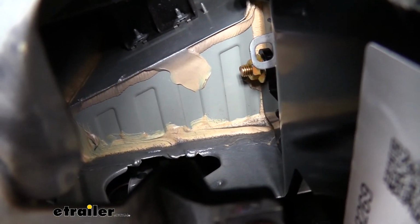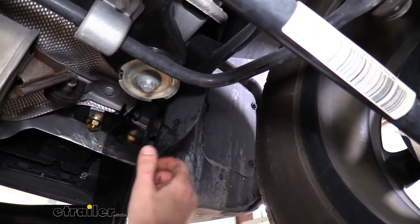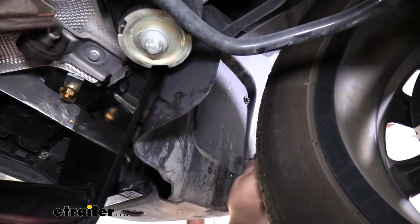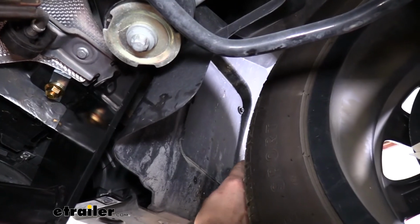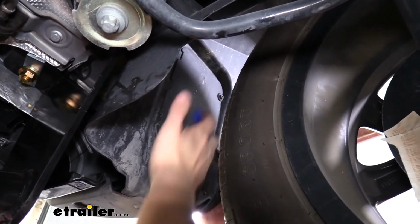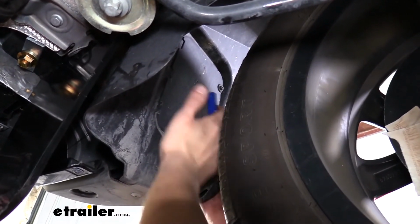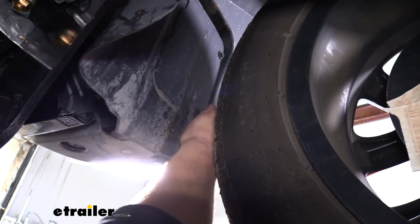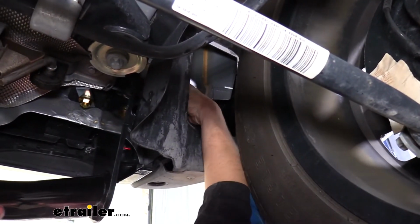On your driver's side, there is an access panel we can remove to make things a little bit easier. You can see here that clearance is even tighter, so we're not going to really be able to get our hands up in there. But there's this panel here, so if we take a Phillips, you can use a stubby little screwdriver or a small ratchet like this with a bit to remove these 2 Phillips screws, and then this cover's just going to come right out of here. These screws are just like push pins, so when you remove the center, the whole pin will just come out of there. Just like that. And then just pull these sides through as well.